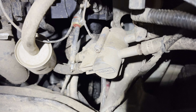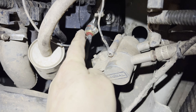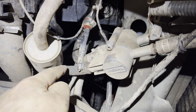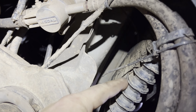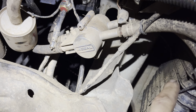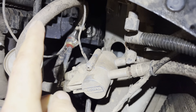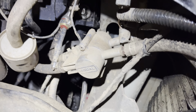So to summarise: from the top return it comes through the filter, then through the sensor, then through the thermostat and back to the gearbox. But if oil exceeds a certain temperature the thermostat opens, it goes into the auxiliary cooler and back. If that's still not enough and temperature keeps climbing to around 100 degrees or above, the switch will turn the fan on to help.